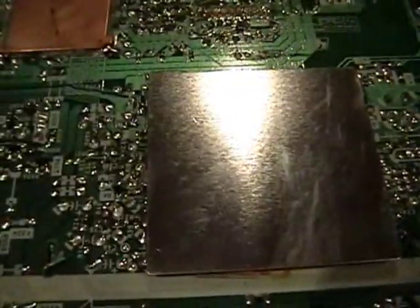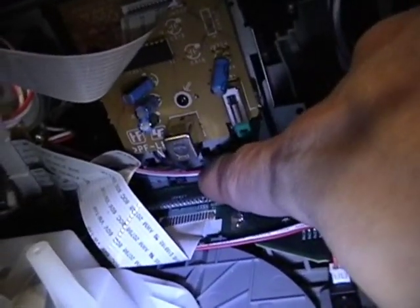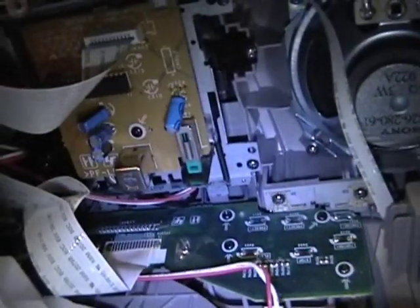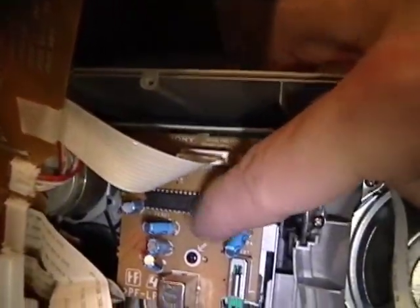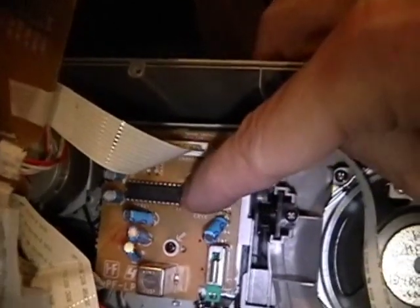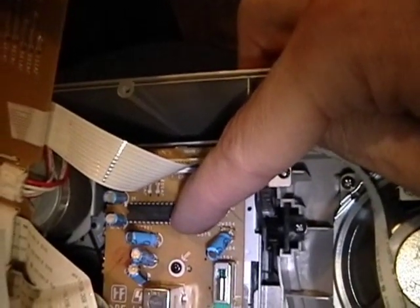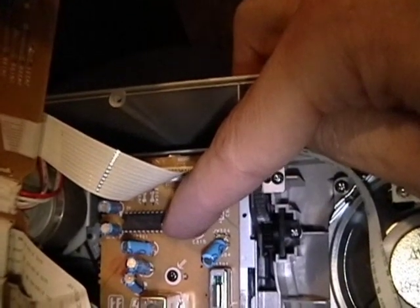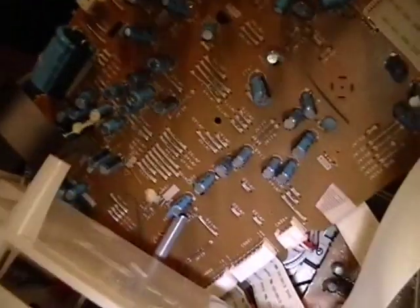I just had to move on. Over here and under this panel is all the tuner stuff because it's digitally tuned. Here's where the tape head comes in, but the internet discussions I found said the sound is crappy if you use the tape input, probably because of the voltage level. There's a chip in here that's a Toshiba TA2068NG. I could not find a definitive schematic for that on the internet — I found a 2068 or 2069N that was close, but it wasn't quite right. So nothing seemed all that obvious on where to tap in.